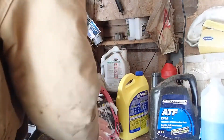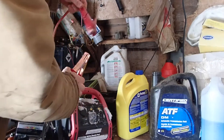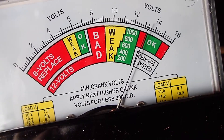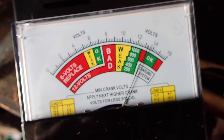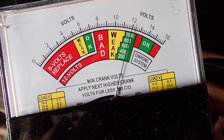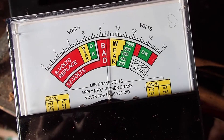For compare and contrast, here's a jumper pack I got from a friend — the battery is completely wrecked on it. It does hold a charge and shows 12 to 13 volts, but if you put any load on it, it goes right down to zero. It's not holding any energy. As soon as I flip it on, it goes right down and that tells you the battery is completely toast. The unit itself is usable — the buttons work, the light works — it's just that the battery is wrecked. You could replace it, but the battery costs $50 to $60, so sometimes it's almost cheaper to get a new jump pack on sale.